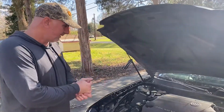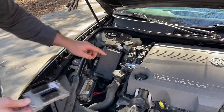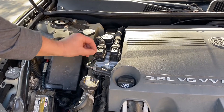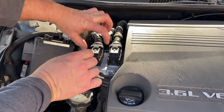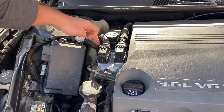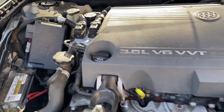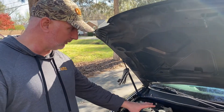We're under the hood here of the 2005 Buick LaCrosse with the 3.6-liter. This is your ECU right here — this is the brand new one. You have two connectors here where the levers flip up and push the connector away — there's a little tab, you pull up and push back this whole plastic piece to pull them off. Be very careful not to break them. Once you get those two connectors off, there are four 10-millimeter bolts that hold this on, and one ground strap that's a 7-millimeter. Pretty simple to replace. Anytime you're replacing a module, disconnect the battery to avoid any voltage spikes.